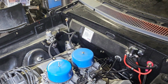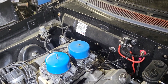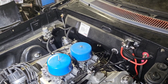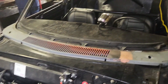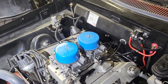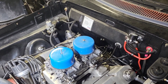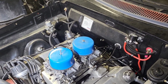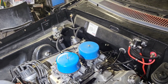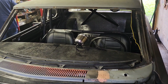So that makes me think whenever I get home, I probably need to turn on my fuel pump and push gas through my fuel injectors. But I already pulled the Holley out. I don't know. But actually, I think mine is... nope, mine is not airtight. I have a rollover valve in mine. So I'm gonna find a cap and go home and tighten up my fuel cell, because it ain't running. Anyway, I'm just rambling on at this point.